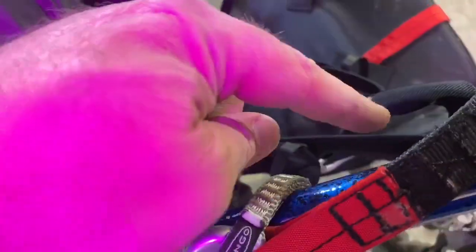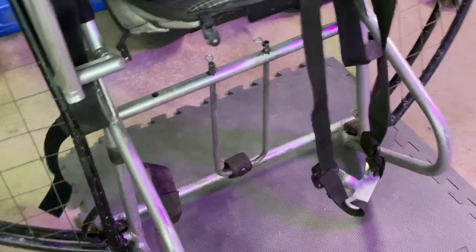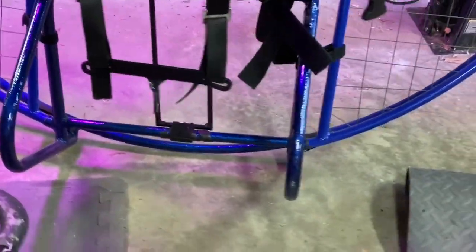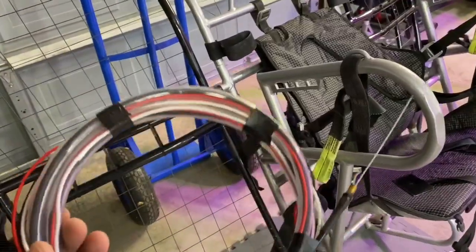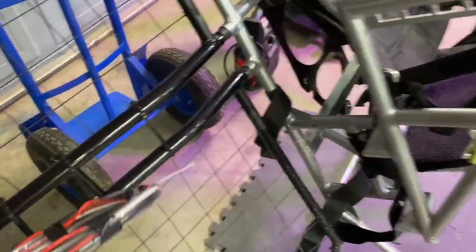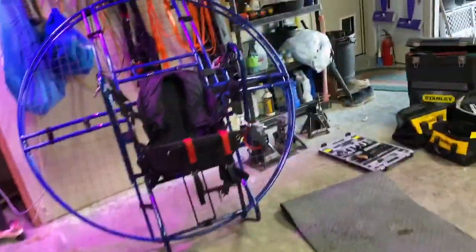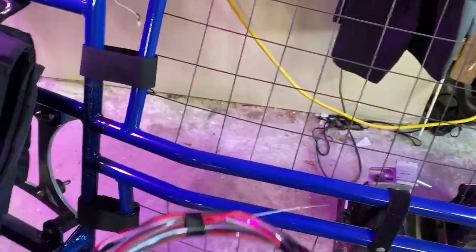I also have anti-torque lamelles — ATLs — and I'm going to put them on this frame to see if they actually help reduce the torque. The harness is adjustable both horizontally, laterally, and vertically, while on the flat top you kind of just get what you get. The gas tank from the flat top will fit perfectly on the Angel. I've heard — though it never happened to me — that the throttle cable can go back into the prop. So what I've done is put a couple of zip ties so that wouldn't happen, and I'll do the same on the Angel so nothing goes in the back.